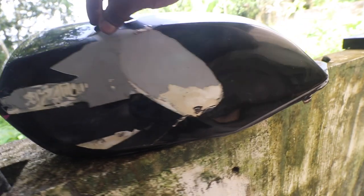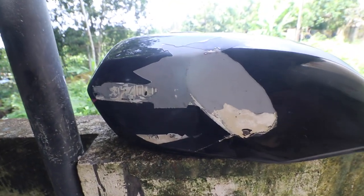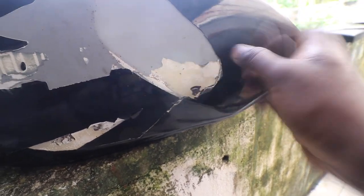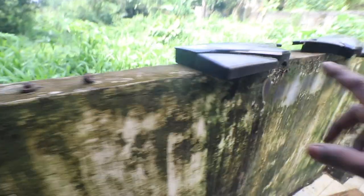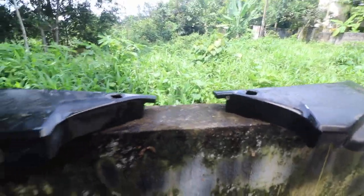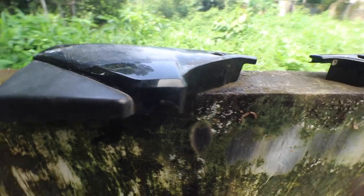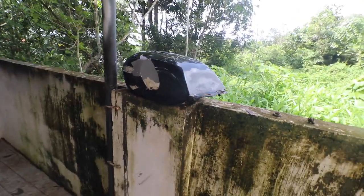I was able to remove the sticker on these two side covers, but it is really sketchy when your paint starts peeling off just like the sticker. So my plan is to apply paint stripper on the tank and get rid of the entire old paint, then start with a fresh new slate. You can see this is a pretty bad fix-up. We are not going to use paint stripper on the two covers since they came out really nice — we will just use 600 grit paper to level everything and then spray paint them.